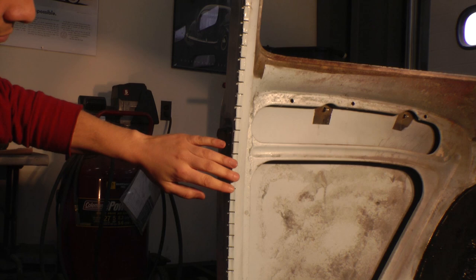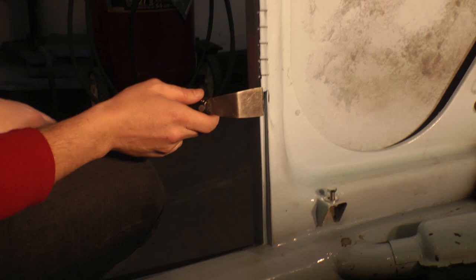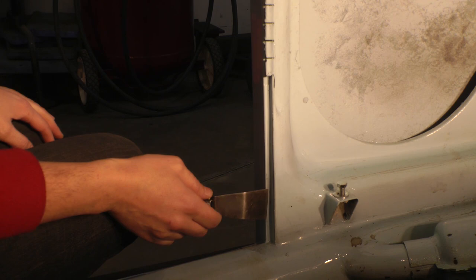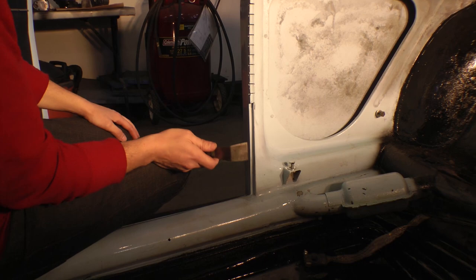As you go down to the bottom of this area, you'll see that the grippers on this car have rusted away. The old grippers came off — they should come all the way down to hold the whole wind lace. We have to improvise here, either using self-tapper screws or small nails to hold the lace in. On earlier bugs you might find grippers rotting away, so you have to improvise. For the most part they usually stay on the cars though.